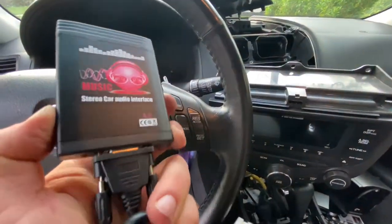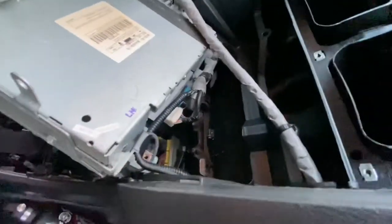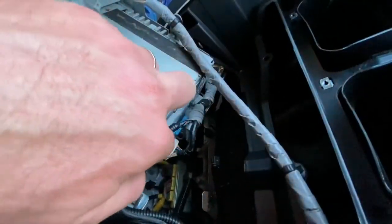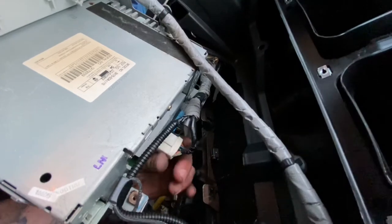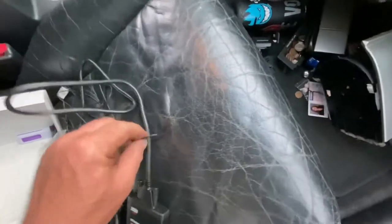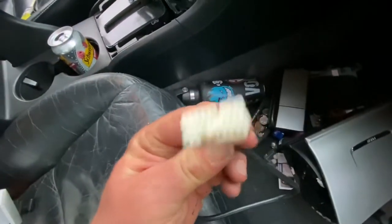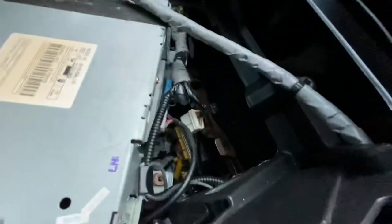On the Bluetooth unit, you're going to connect this serial connector to it on this end. We're on the passenger side, and because of the wiring constraints, this is just the way the radio is going to be orientated. Now go into the back here and you can see this white connector. From underneath, take a flat blade screwdriver and push up on the little tab, and this guy will pop right out. Your Bluetooth receiver should already have your serial wire hooked up to it. With the kit, depending on what Honda you have, it should come with the appropriate plug. You're just going to slide it right in there until it clicks, and that's it — your receiver is in.